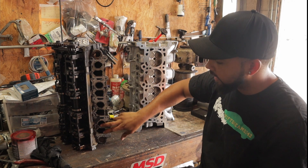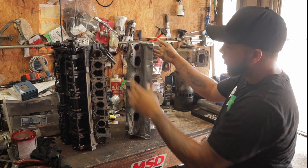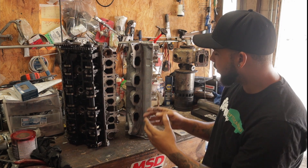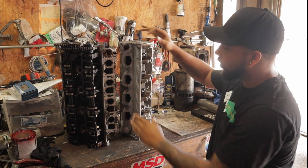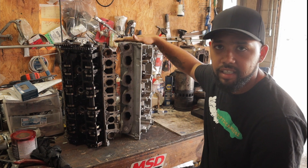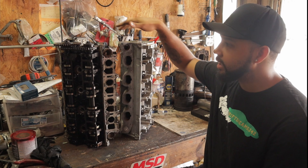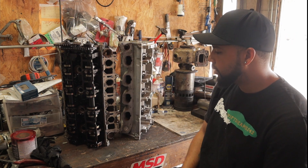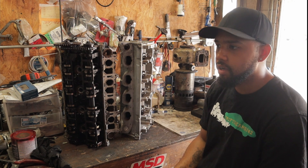When you turn it to the side, you can see what I mean. On one B head you have eight ports — two, four, six, eight — whereas with the C head all you have is four big ports. That's already an advantage for air-to-fuel mixture; it's going to be much better in the C head. The cam arm profiles are also exactly the same. This is a C head from a 2003 Mercury Marauder and a B head from a '94 Lincoln — think about that: almost 10 years apart and they still use the same cams.